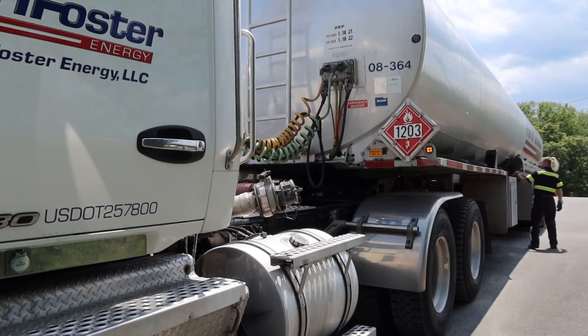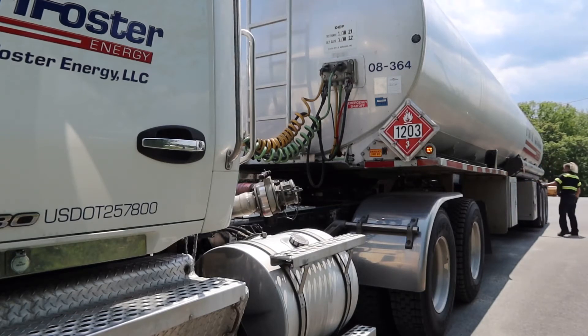I'm underneath to make sure my fifth wheel is locked properly — I always double-check that. Then I make my way down the side of the trailer, making sure my boxes are all secure, nothing is wearing out, and the landing gear is secured. I check the trailer tires: brake components, tires, tread depth, rims, lug nuts, nothing between the duals — working my way down all three sets of tires and climbing in between to make sure everything looks good.